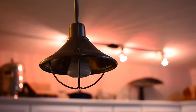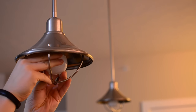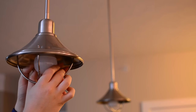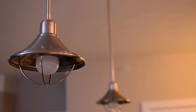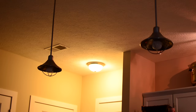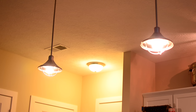Here we have an actual Hue Lux bulb in a light socket and we're going to put in the new dimmable Hue White bulb to compare them. The first thing you'll notice is it's going to come on right away when you plug it in, as long as there is power to that light. It looks pretty much like a standard bulb compared to the Hue Lux, which is very flat. It is 50 lumens brighter — you can see the one on the right is maybe slightly brighter. The other thing is it's faster: the new bulb turns on and off much quicker like a traditional light bulb, whereas the Lux and regular Hue bulbs have a delay of half a second to a second before they fully come on.